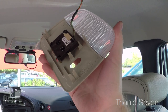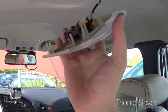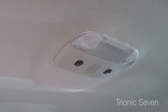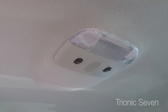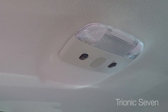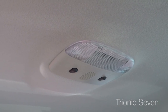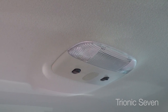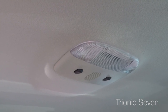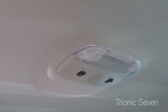This doesn't really have a separate part number - if you look in the Saab catalog you need to buy the whole light cluster as one package. I bought this used from Victor, so I'll be installing just the sensor in my light cluster. You just snap it onto the cover and put it back. The lamp cover went on as easily as it came off. So at this point we have the glass crush sensor installed. If you have a four-door sedan this is the only sensor you need. If you have a wagon or five-door you'll also need to replace the rear light cluster in the roof of the trunk.